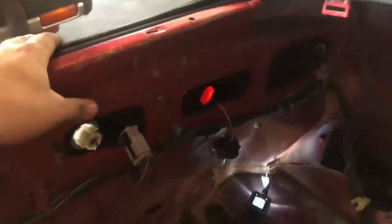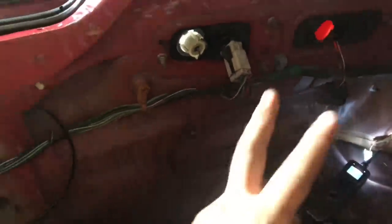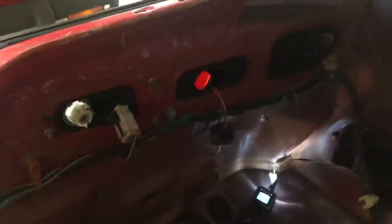The main idea is we're gonna have four wires off of a relay on a switch — two for the front headlights and two for the running lights in the back — just turning on off of a switch. Then off of the brake pedal switch we're gonna wire in the other wire so it only comes on when we're hitting the brake pedal, as brake lights should work. The black wire will go directly to body ground.